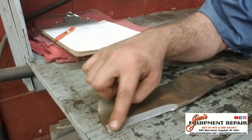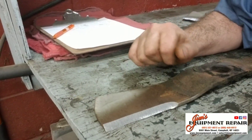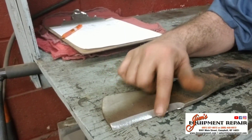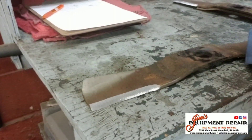There's no significant rounding of this corner of the mower blade and there's no significant gouges. We've cleaned up the small gouges that were here on this cut tip, and the rest of the blade looks in pretty good condition, so I'm going to go ahead and reassemble.